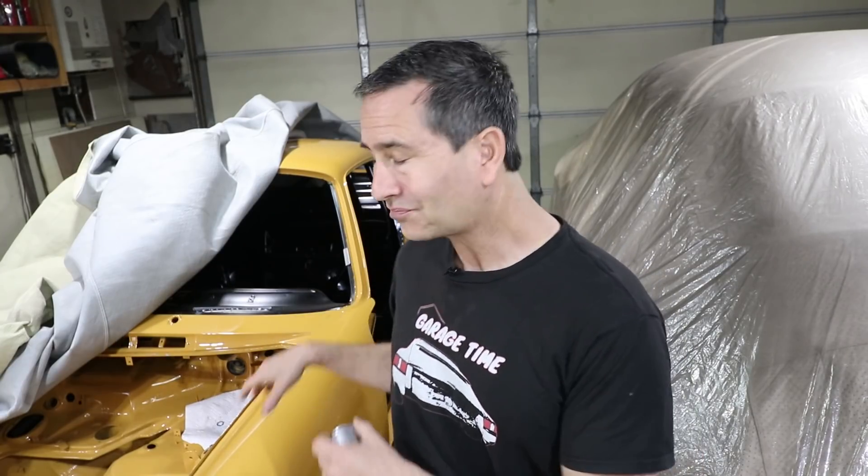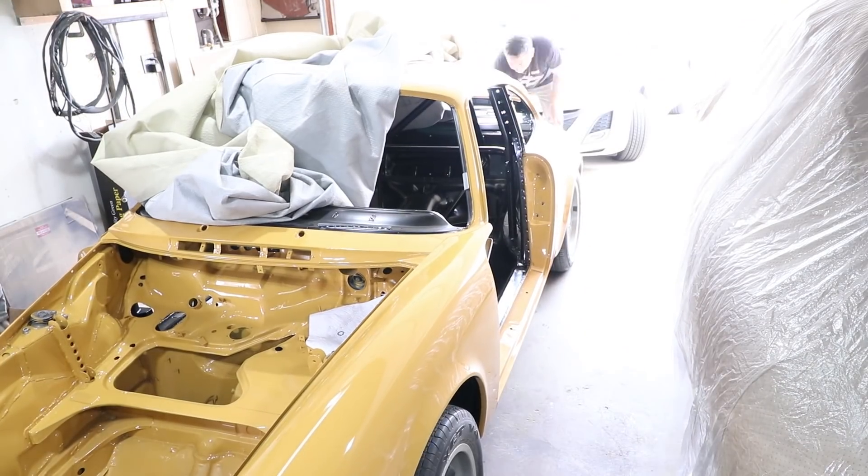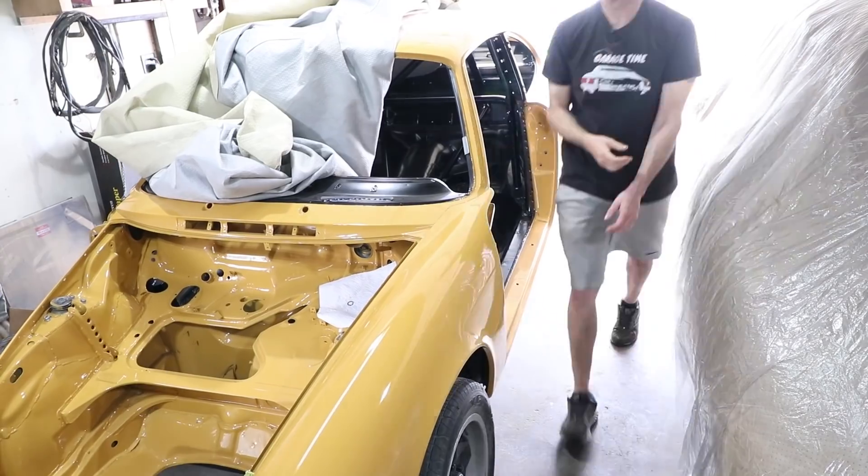Come to find out, I don't have the nut that goes on the steering shaft. This car never came with the steering wheel — it didn't have a nut on or anything. I went to the store and apparently it's an odd size: M18 by 1.5. They had M20, they had M16, but no M18. So I ordered that nut — I think it'll be here tonight. I'm going to move on to the fuel lines, jack up the car, go underneath, and try to install those stainless fuel lines I made a few weeks ago and get them through the tunnel.